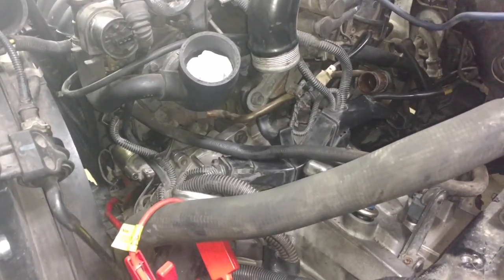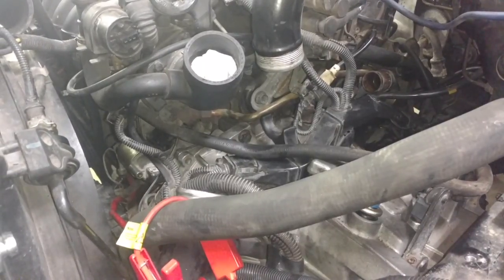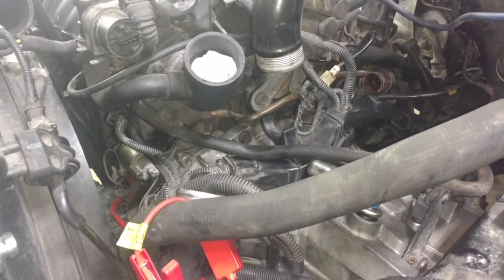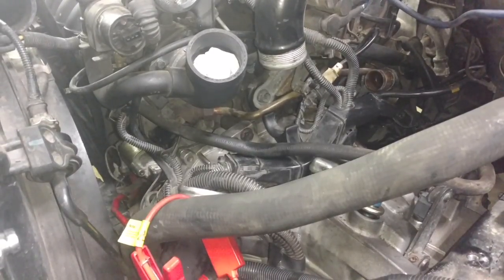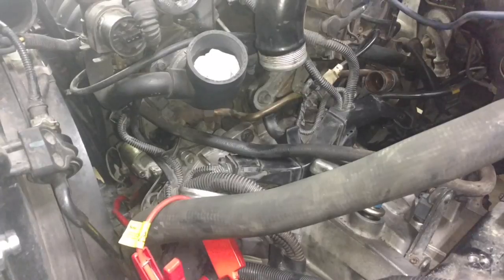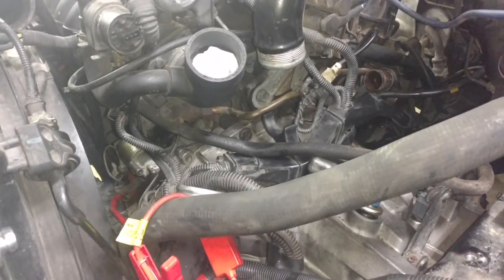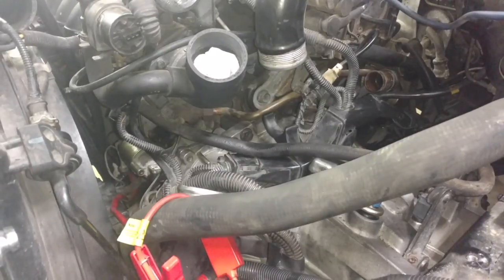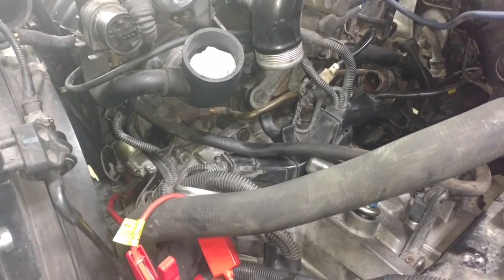That way, when you raise the transmission and mate the transmission to the engine, those splines fall in place for the crank and all that stuff turns when it's supposed to. So you want to make sure you have that centering tool, very simple tool for your clutch.